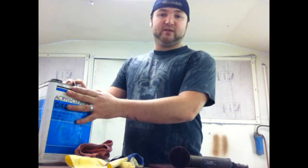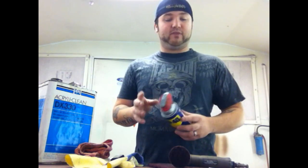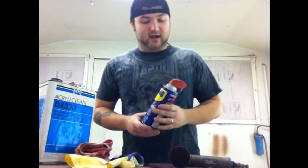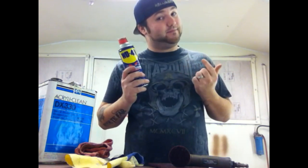Now I'm going to show you the cleaning part. Today I'll show you different chemicals, tips, tricks and tools you need to use to clean your welding areas. For chemicals I use acrylic clean or a wax and grease remover because it evaporates quickly and the residue left behind is slim to none. A lot of people like to use WD-40 — I don't, because the residue it leaves behind can screw your weld. If that's all you have, wait about an hour or two, or you can heat up the metal.